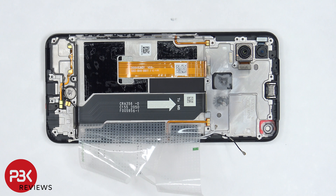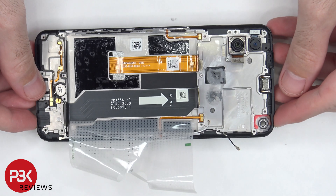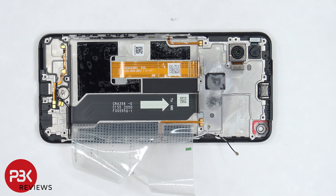So if you need to replace your screen you would have to remove the back plate as well as the screws on the back housing and the back housing itself. You disconnect the battery cable and the screen cable and pry the battery off, and then you would heat up the front of the phone where the screen is to loosen up the adhesive underneath. You pry your old screen off, apply new adhesive, reapply your new screen making sure you run the flex cable through the opening, and reassemble your phone.